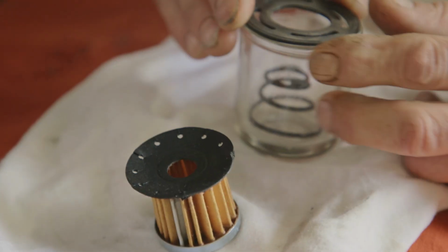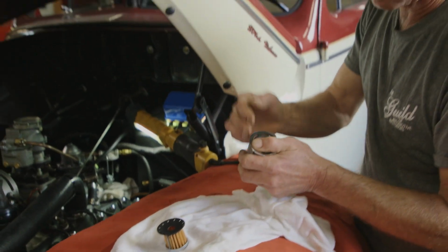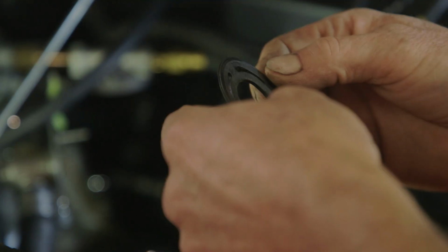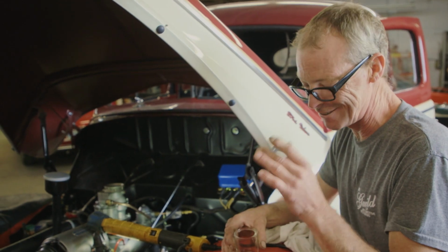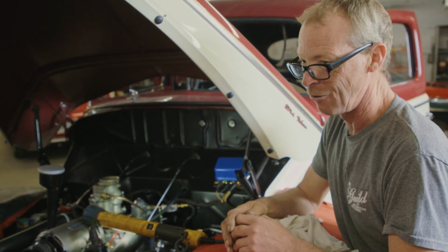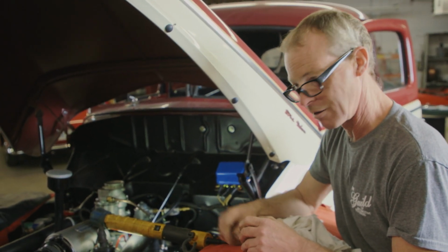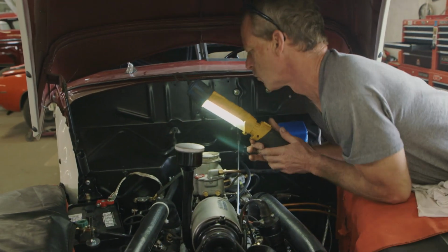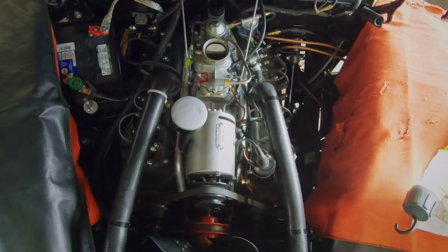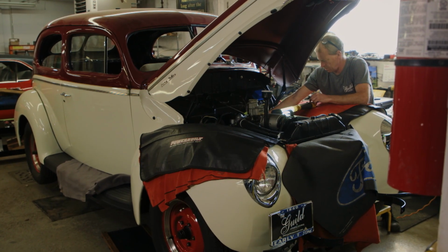and it's supposed to set inside there and it's supposed to seal it. So I'm figuring that it's sucking more air than fuel, right? Because I've seen this many times before, just a little $3 seal and it won't go. And then you'll start putting a fuel pump on it. Then you start putting a carburetor on it. And then the problem is right back here. So restoration should have a slash headache beside it. Like restoration equals headache. Because it is, it's not that easy.